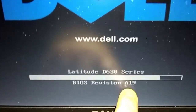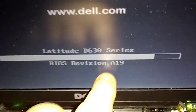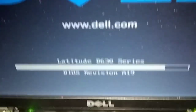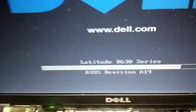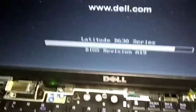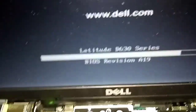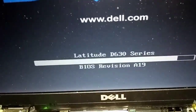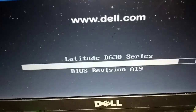Check right here for your BIOS version. On the D630 and D620 Latitude, mine says A19 — that's where you want to be. If you don't have that one, check out my playlist; I showed how to upgrade the BIOS. You might have an old one — A17, A15 — you want to get up to the latest BIOS, A19. If you replace the CPU and also the BIOS, you want to have the newest one. It gives you a lot more functionality in the BIOS.